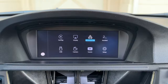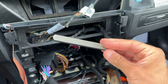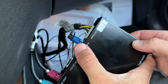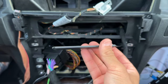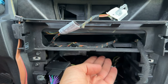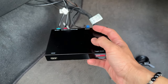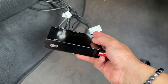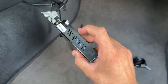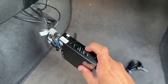To make sure everything works, go ahead and start scrolling the iDrive knob — you'll see the system is responding, everything is scrolling around and works as it should. Now take the Wi-Fi antenna that's provided, route it underneath the kick panel, and plug it in where the blue connection is. Be sure to mount this to anything that's plastic, not metal. Something notable right off the bat is the durability of this unit — it uses a steel frame so you don't have to worry about denting or getting dinged up, and there are cooling vents off to each side to prevent overheating.